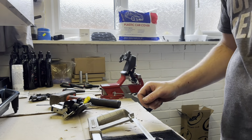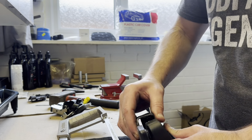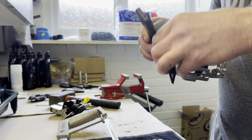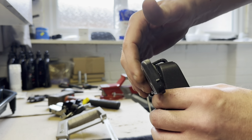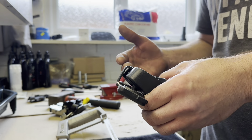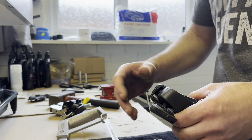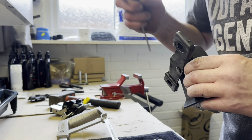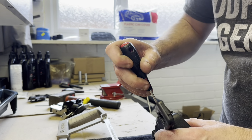Okay, guys. That was a little bit more than I anticipated to get that shaft loose, but I've done it now. Well, just about. What I recommend doing if you're going to do this job: buy this piece here, buy this bracket, because if it's jammed like mine is, I couldn't figure out a way to get it other than cut it. So there's a little bit of damage from me trying to hacksaw it off, which I've done, but it's still wedged in there just barely by the piece I've cut, but I should be able to push it out in a second, hopefully.